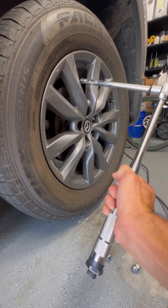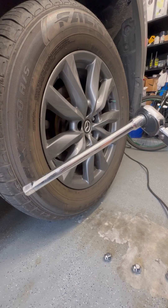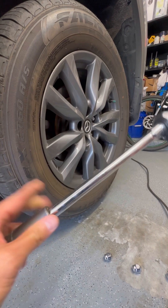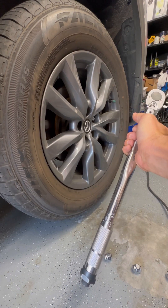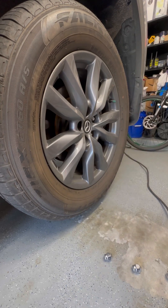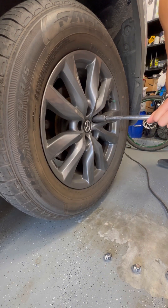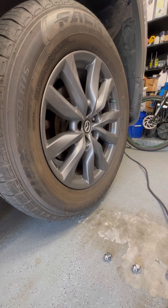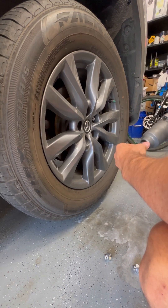To get more leverage, I'm using a torque wrench with a half-inch, I believe 12-inch extension, and then I put my socket on the end. Basically we're creating a longer lever to get more torque on that one lug nut that's sticking. The impact wrench just didn't quite have enough torque to get it out. And there we go — got it loose. Sometimes you just need a bigger lever to get things off.